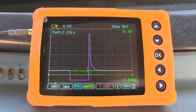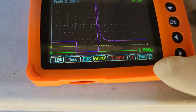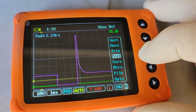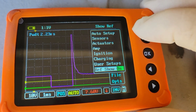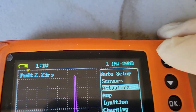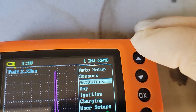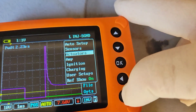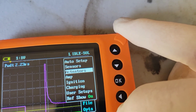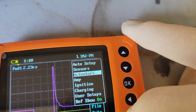So that is testing a fuel injector. What I did was — down here you can see the M is highlighted — hit OK, go down to preset and hit OK. Now use the up and down arrows to scroll up to actuators. Right there it says 'inject L injector secondary SGND.' I'm not sure what that stands for, but basically you just scroll left and right until you get to where you want — whatever you want to test: injector with an amp clamp, injector, idle solenoid.